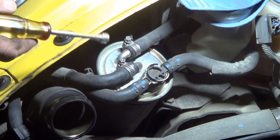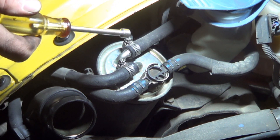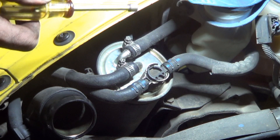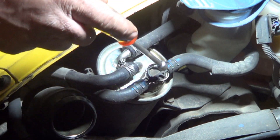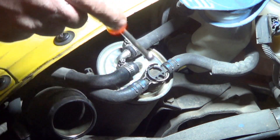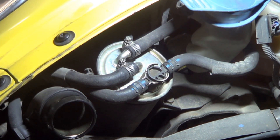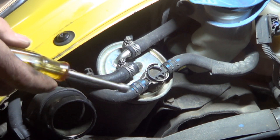In my own TDI, my wife was traveling and she put gasoline in the car. The car, of course, died a couple blocks later. She took it to a shop and had them clean out the gasoline and put diesel in it, and they installed this backwards — meaning these two hoses they put here and here, and these two hoses they put here and here. Well, that was fine up until the point where this thermostatic T started working when it was cold, and then we started having problems. It didn't take me long to figure it out.